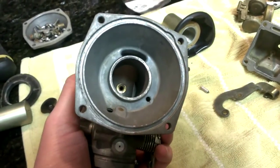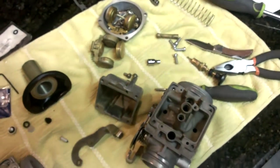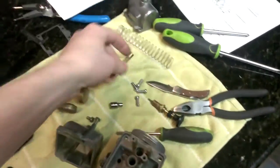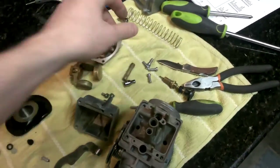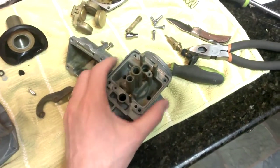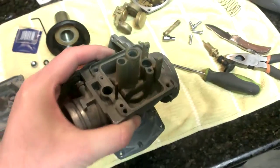I ruined this one already because I tried to tap it through from this side with a screwdriver — I was an idiot. I ruined the lip on that receiving end of that needle jet, so it's probably going to mess up the fueling. But either way I've got two carburetors here. I've already pulled this other one out so I'll clean it real good. That one always eluded me — I never figured out how to take that thing out — so I'm taking a video to show you.